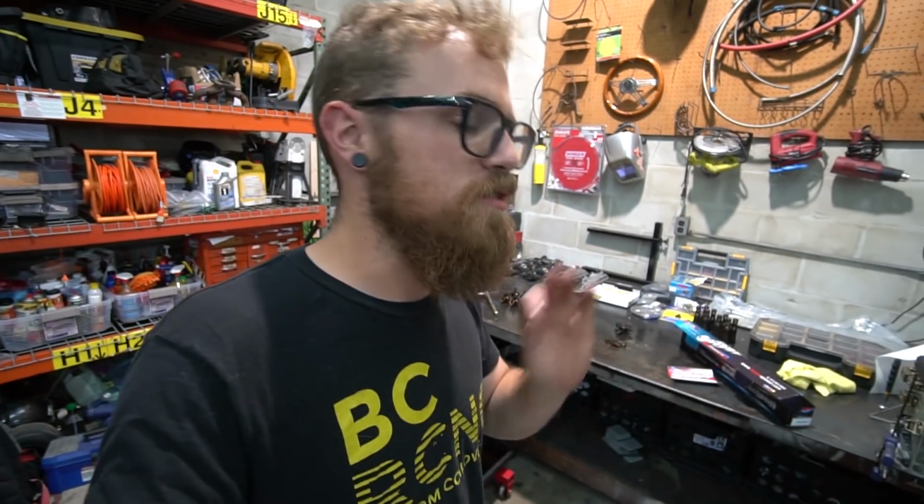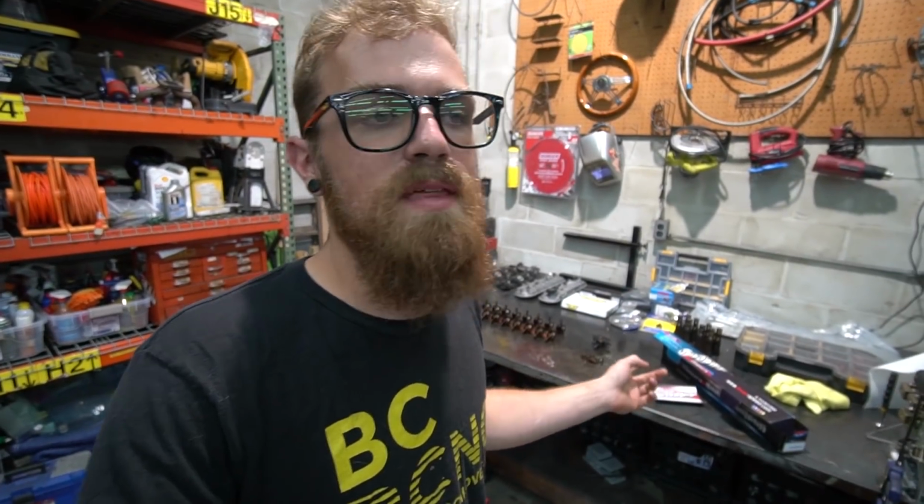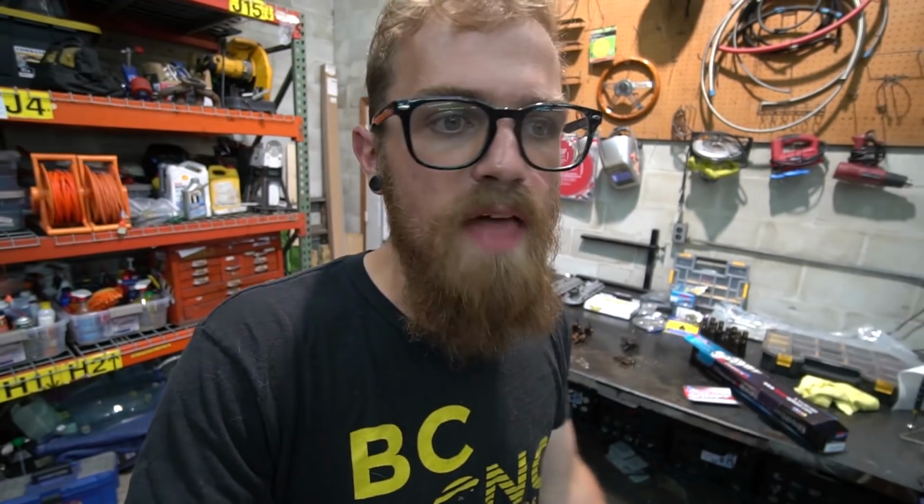And they were so helpful because I needed that cam retainer plate. So not only are they exchanging the cam for me, but they're going to get the cam out today with a cam retainer plate and some even gnarlier valve springs, because the stiffer valve springs will also help us prevent valve float and any piston to valve issues. And they're getting all of that out today and overnighting it, so it'll be here tomorrow.